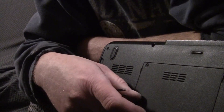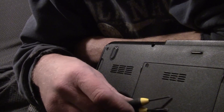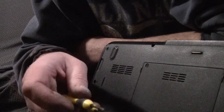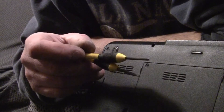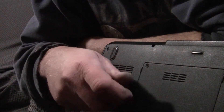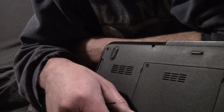There's a whole lot of debate on these 1545s, 1526s, and a few other Dell models about whether you should upgrade your BIOS. I leave mine alone — I've upgraded two or three of these and A13 works fine. I've heard that with A14 your keyboard starts having trouble and your monitor will start having trouble. Even on the Dell forums people talk about keyboard issues with A14 on a Dell 1545, so I just leave A13 alone and the processor runs fine.